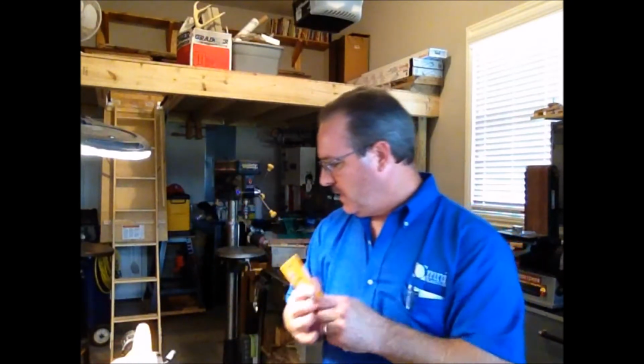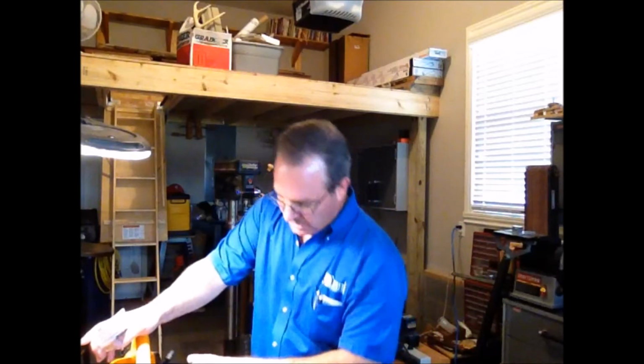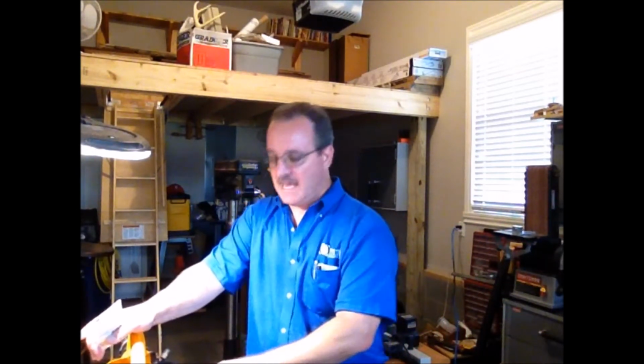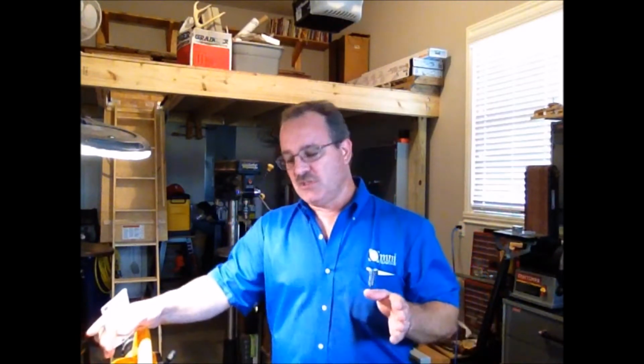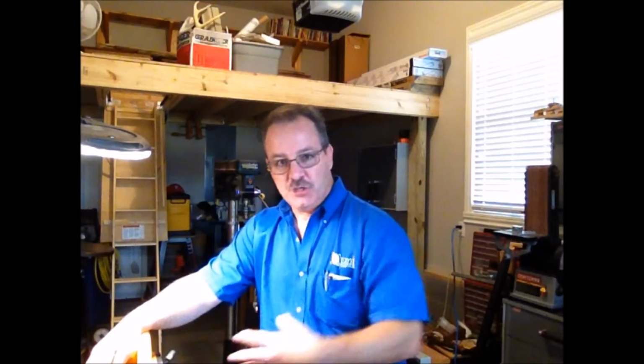And one of the suggestions I really liked is possibly I'm pumping the gas pump too many times. It says on the instructions to pump it 6 times, but the concern was from Steve Tidwell, and this is really interesting, is maybe you only need to pump it 2 or 3 times. Maybe you're getting enough gas flow into the carburetor and you're putting too much in there, which is flooding it and making it difficult to start. That makes a lot of sense.